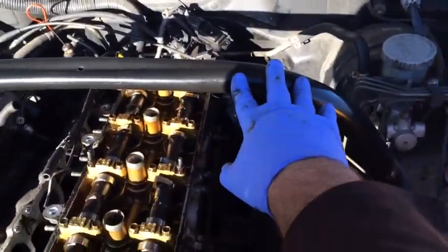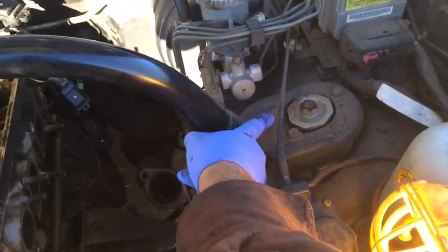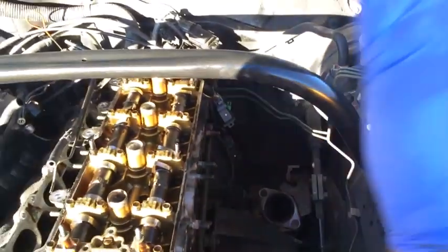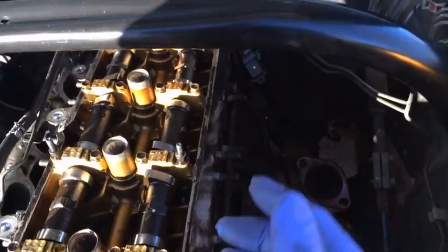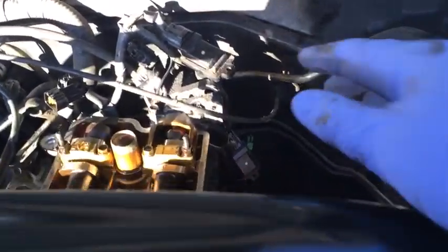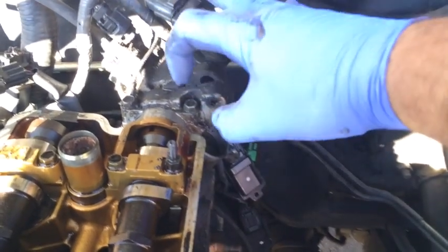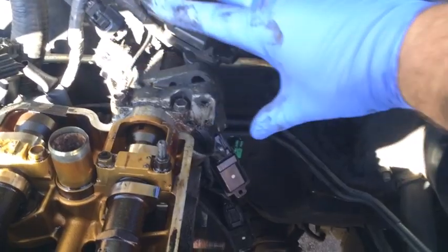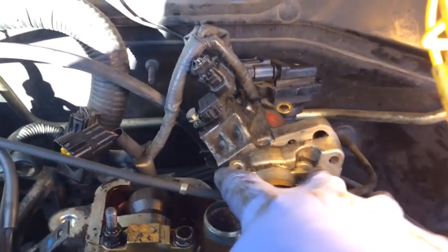The coolant tube is out of the way - just took a good yank and it popped right out. Next, just to make some room, we need to remove this strut support bar, which should just be these three bolts on each end. That's going to give us room to lift things up and out of the way. This is going to be heavy after we remove it.